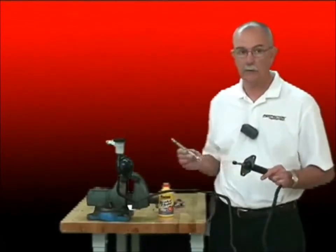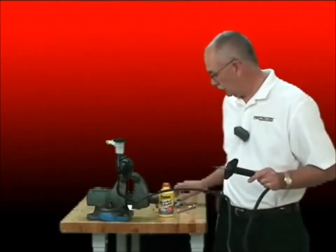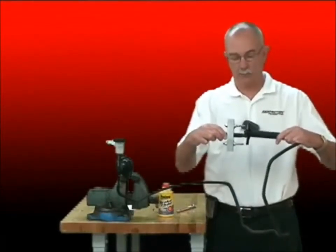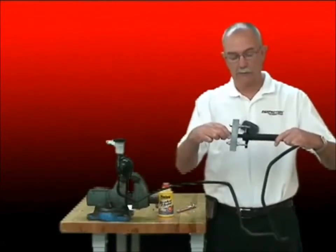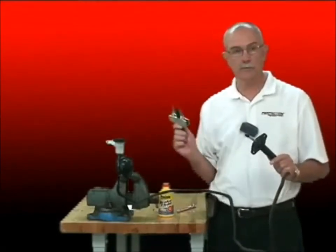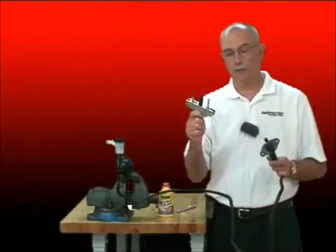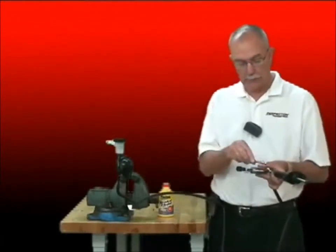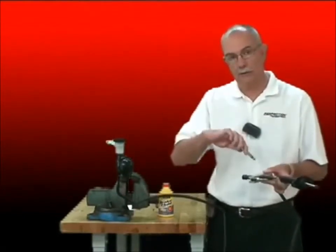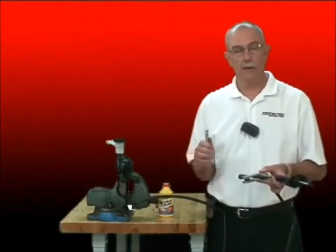Special tools today? Very simple. A common 3/8ths extension — I'm going to use that as a substitute pushrod. Here's something that really helps: this is a steering gear puller or a harmonic damper puller; either one would work. I'm going to attach this to the front of the slave cylinder after I remove the pushrod — this will block the piston. I'll be able to feel in the pushrod of the master when the system is bled. We'll put some DOT3 in and get started.